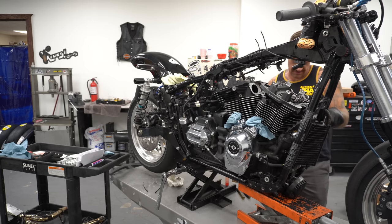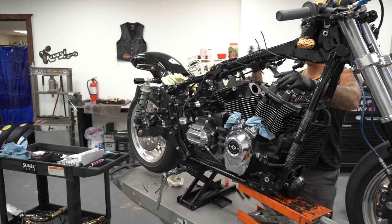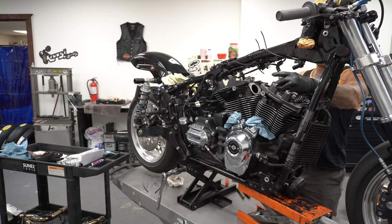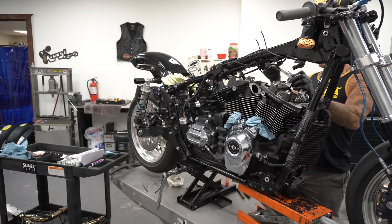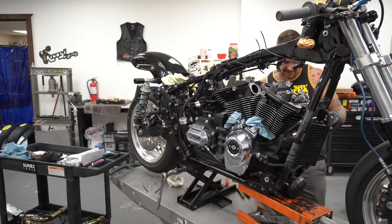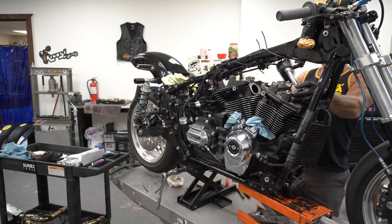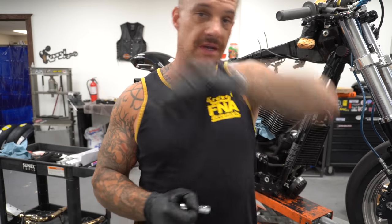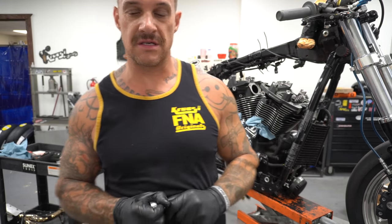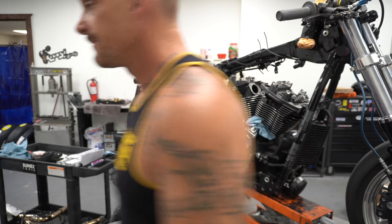Now we're going 20 pounds. Now 25 pounds. We're gonna go up by 5 pounds up to 45 pounds now. And that's where we're gonna end. That's that, heads are torqued. I'm sweating. Got hair grease coming down my forehead. Always zero out your torque wrench when you're done, because if you put it away on the poundage, it's trash.